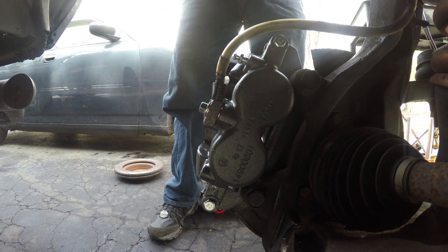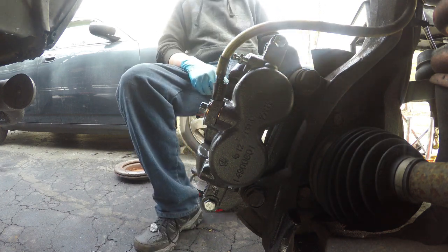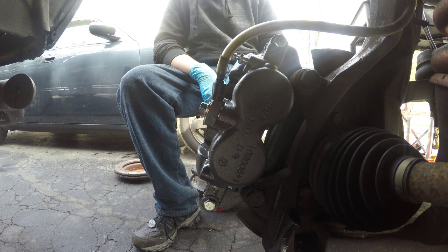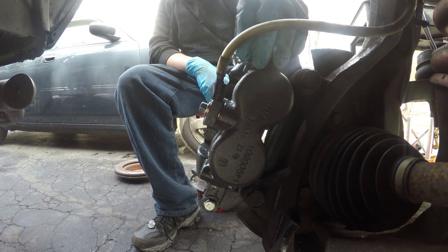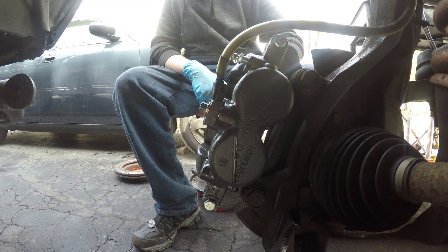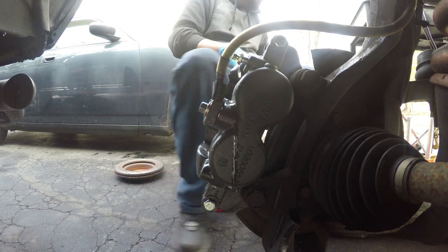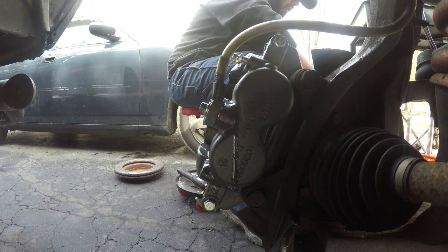You're going to need a bottle of brake fluid — preferably a big bottle if you do more than one caliper, and definitely a big bottle if you're going to do a full brake flush since you'll be flushing all the calipers. There it goes. Sometimes you've got to loosen the bleeder screw a little more and then it pops open. With that being said, I'm going to hook up my vacuum bleeder.